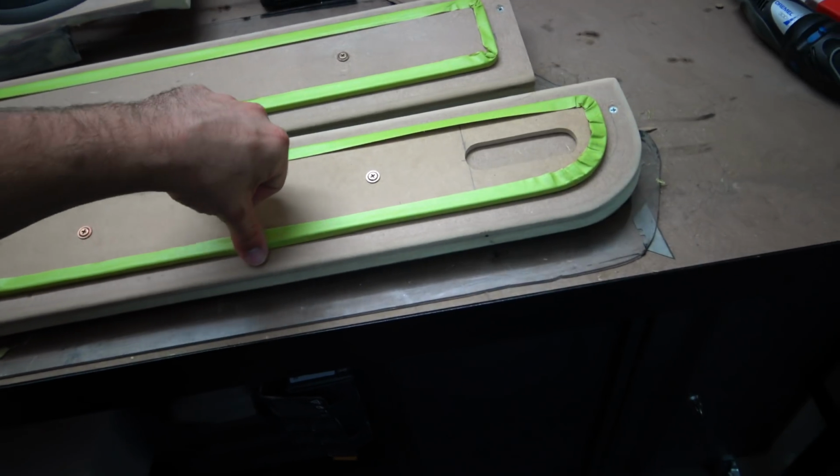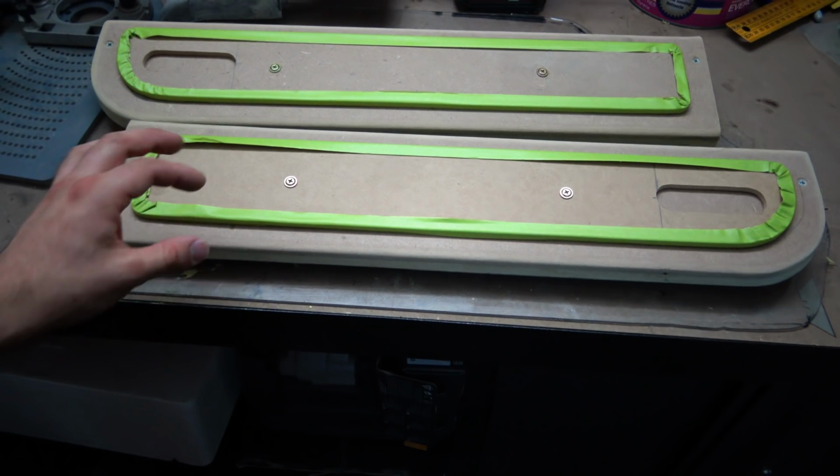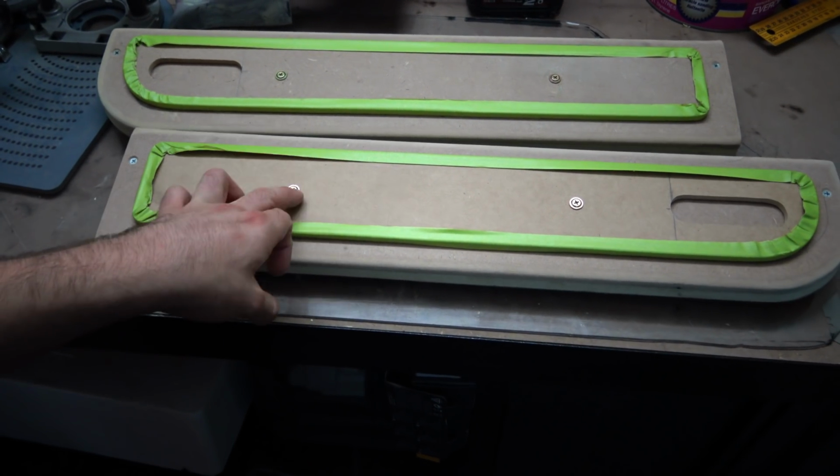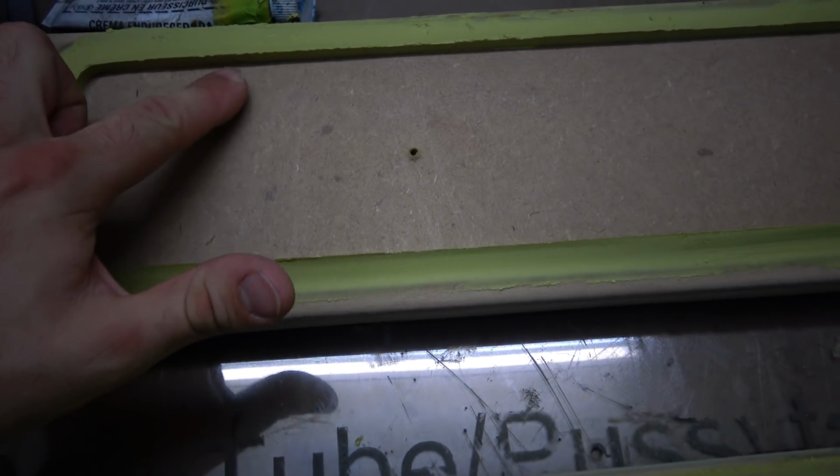So all I'm going to have to do is just a little edge all the way around body filler, and then as I said, when the body filler gets nearly set, that kind of rubbery stage, I'll take these 2 screws out and then slowly wiggle it out. So that popped out perfectly, as you can see the edge.